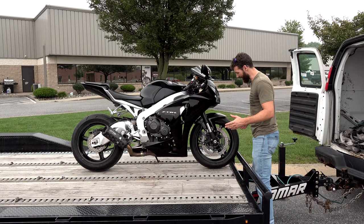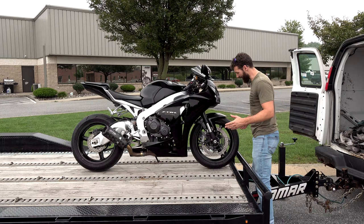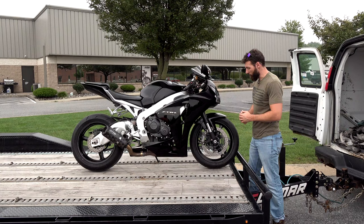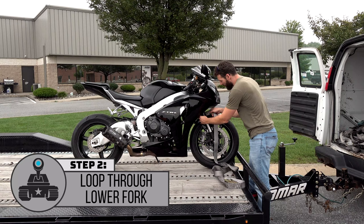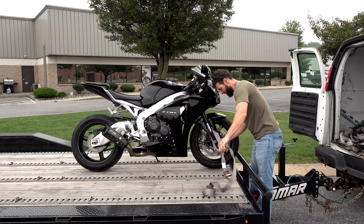Another thing I do — I also leave the bikes in gear. Now this is going to be pretty much the same thing for the sport bike. You don't want to get it up high on the handlebars, you don't want to pull the handlebars down, you don't want to crush the suspension. In a closed trailer you could wrap it on the handlebars and pull it more sideways, but I still don't like the idea of crushing the suspension. It's much easier just to take it from down here. I know what you're thinking — you're probably thinking this is too low on the fulcrum, it's not going to feel stable. We'll strap it down and test it.